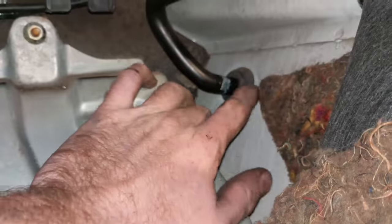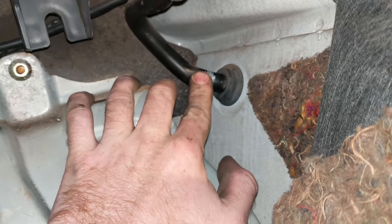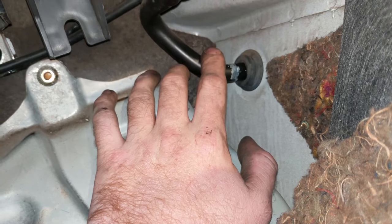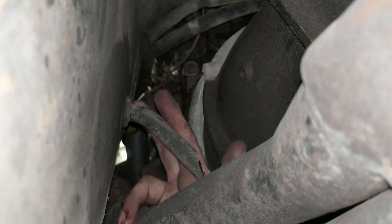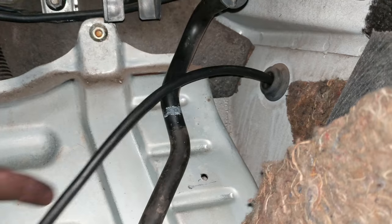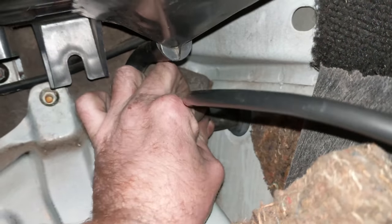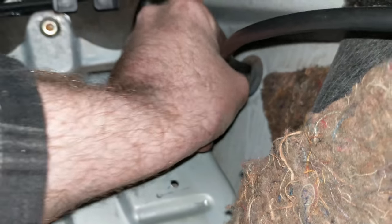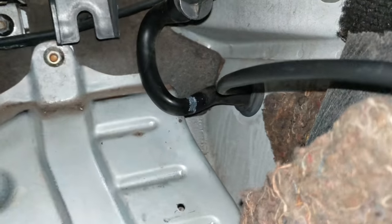One of the hardest parts of this install is feeding the cables through the firewall. On a 1990 Australian NA6 you've only got eight feet of cable to play with for the sensor. Down in the passenger footwell on the left-hand side you'll see a grommet — a piece of rubber pipe that dumps outside the car — and we're going to feed our sensor line through there. The best way to use this grommet is to completely pull the tube out, feed your oxygen sensor cable through, and then put the tube back where it goes. Much easier than trying to shove both through at once.